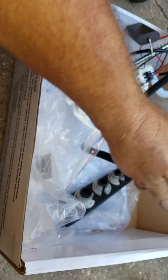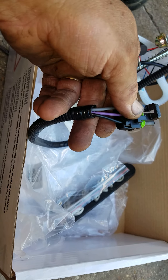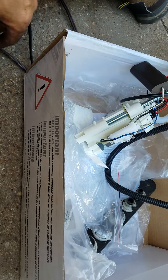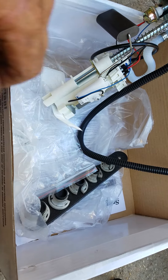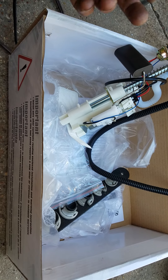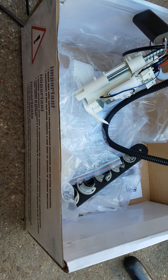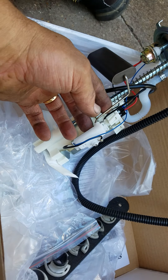The Schrader valve pressure release is behind the throttle body on the passenger side on the fuel rail — it's not hard to find. I think this is a plug-and-play deal, but I'll have to verify that the wires correspond. Some cheaper fuel pumps you have to mess with the wires. This one doesn't look like it comes with wires, but usually if you have to change the plug it will come with a new plug and directions. I'm going to get this thing popped in there.